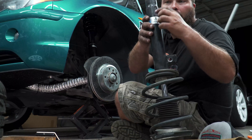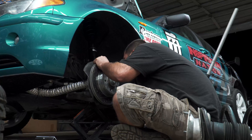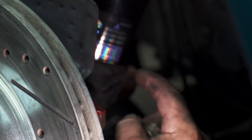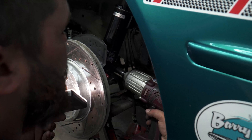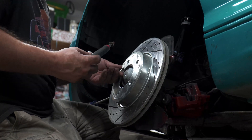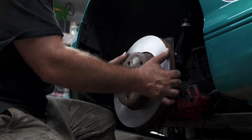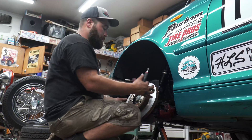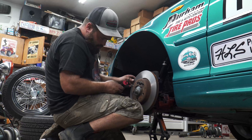The D2 coilover does have lineup pins that slip down in the back groove of the spindle, so make sure you get that lined up properly. Once you have the coilover seated in the spindle, reinstall your 18mm bolt. It's a good idea to put some anti-seize on these bolts so that they don't get stuck — this one was a little stuck and did not want to come out. Be careful with the anti-seize — you'll end up looking like the Tin Man if you don't watch out.